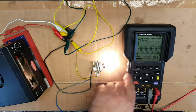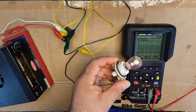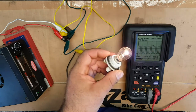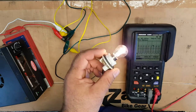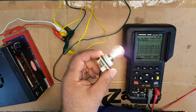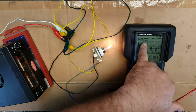So extremely useful. But what we're seeing here is a device really that's triggering still quite slowly. I mean, if you could imagine an injector on a car, on an engine that's running at, say, 3,000 RPM, that injector is going to be operating on and off much, much faster than this, a lot faster. And even a voltmeter is, at the moment, struggling.